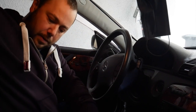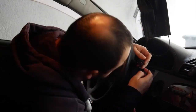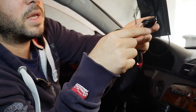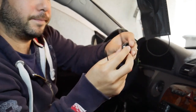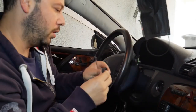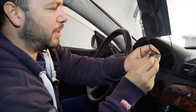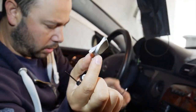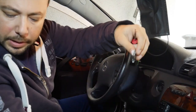Here is the button itself — the two little torx screws go in here. You have to squeeze these little legs so you can take the button out of the assembly. We push the button outwards and it just pops out. We're going to replace this button with the little paddle shift button — looks like it's this one.